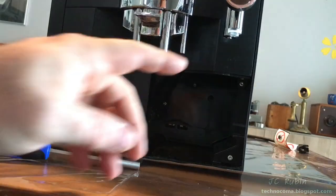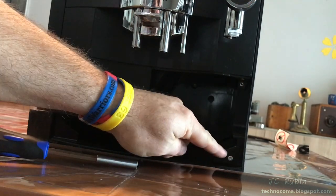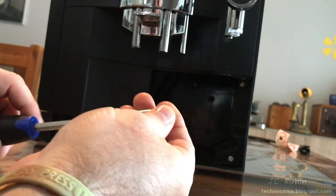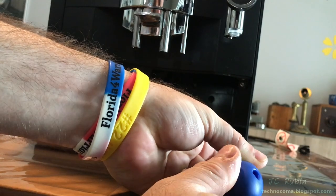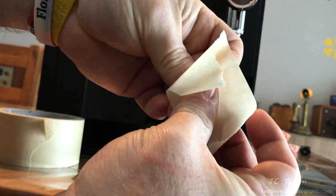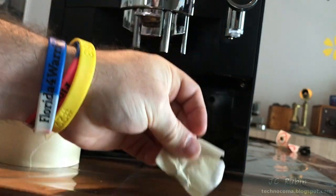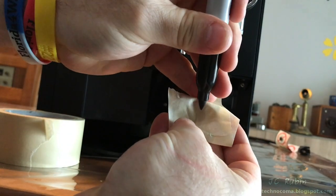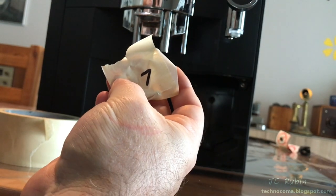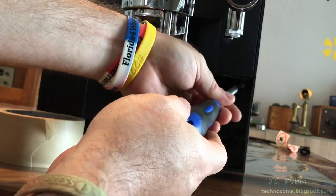Starting at the front of the machine at the bottom right — this is going to be number one, and we'll use a T15 fitting on the driver to pull that one out. I'll wrap the screw in masking tape — for all I know all these screws could be the same size, but I'll know which went where. Take a sharpie, annotate it with number one, put it on the pile, and move on. The screw in the top corner is going to be number two, again T15.